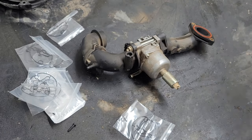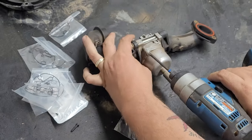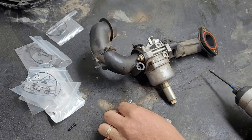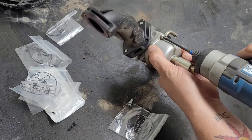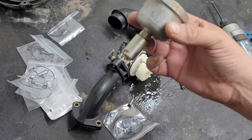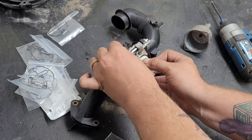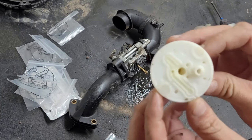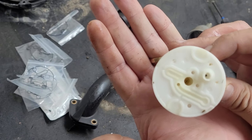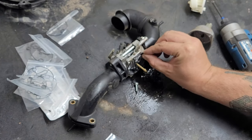I'm going to show you what fails. We're going to take our Phillips screwdriver and just take off the two float bowl bolts — one and two. Like I said, we don't have to remove the solenoid at all. Now pull this off. Be careful — there is a little brass piece in here, you can see it all the way down there. Sometimes that likes to fall out. Do not lose that brass piece.